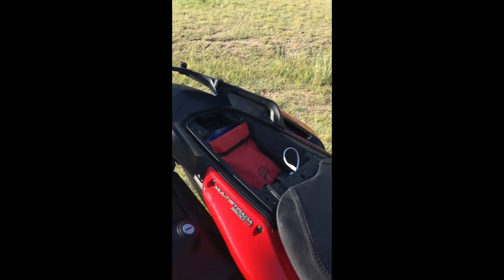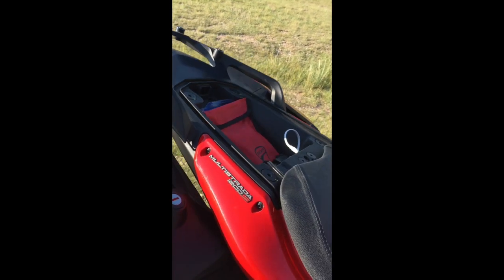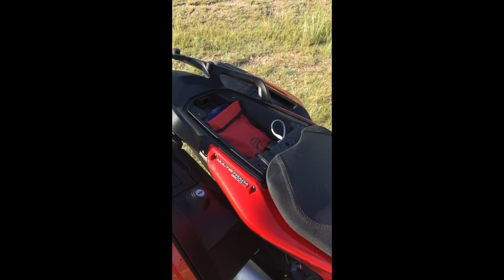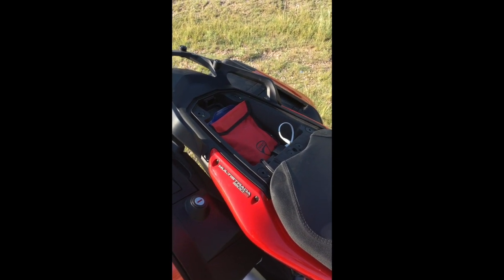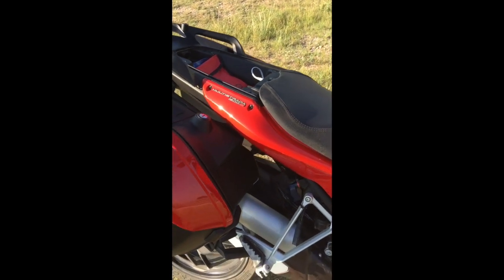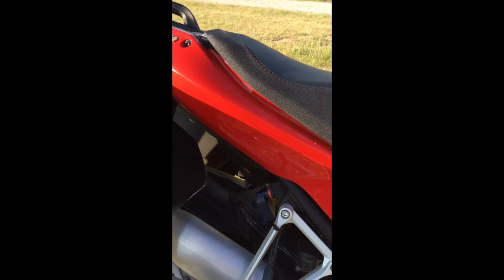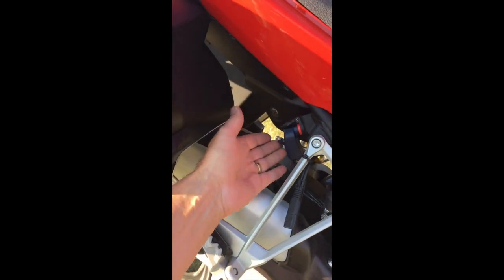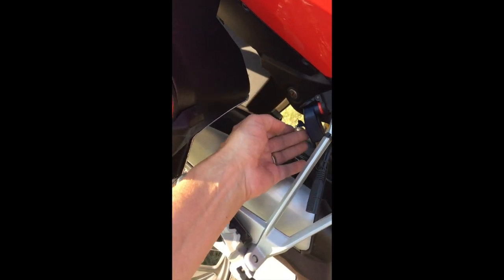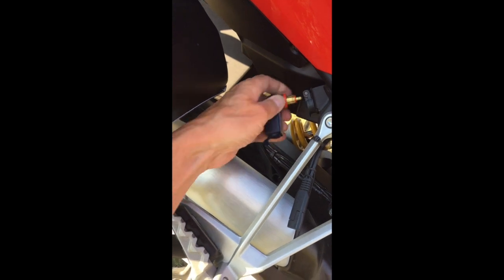And if you've had any time with this bike, you know there's a key lock on that, and that passenger seat opens right up, and you can get that wire snaked into there, and you could put the iPhone there. Now that worked, but after the first ride I realized that this connector is so close to the pipes, and that wire is so close to the pipes, and the standard iPhone wire is not meant for this kind of environment, that I was afraid something might melt back here, short out. It's really a temporary solution.